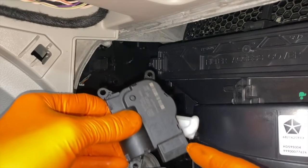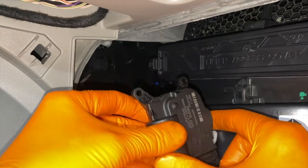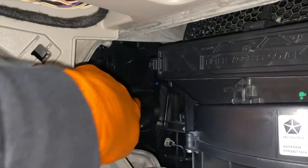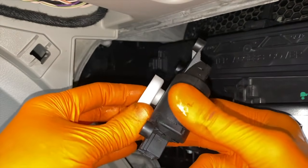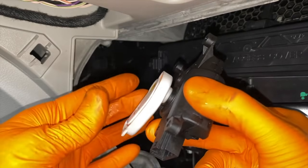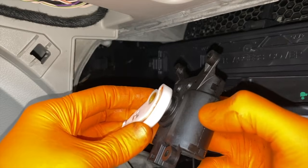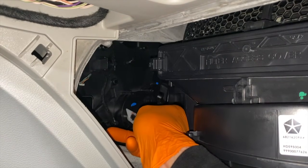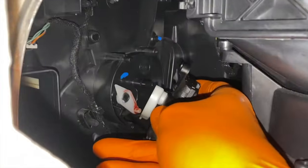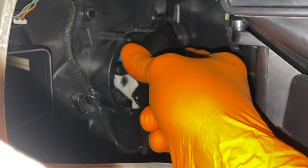In addition, the electrical connection point is on the bottom. There's going to be a screw here, and this hole right here goes up onto that tab right there. And as far as this part right here, DIYers, do your absolute best not to rotate it. You'll break it. Inside here is the electronic motor, and it is that motor that moves this, not you. Coming inside here. And again, aligning it properly with that lower tab inside. There we go.